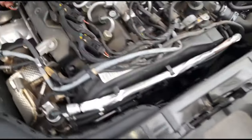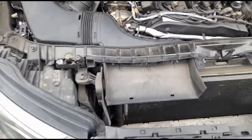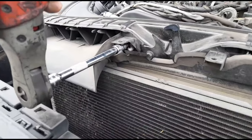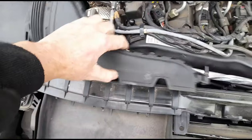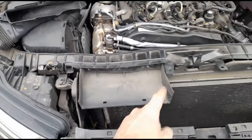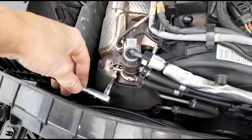Anyway, I've taken off these plastic clips and we can remove this front piece of plastic. Just in here we've got a couple of T25 Torx screws. You can take out this plastic — you can see where the screws come in around the back. There's one screw on each side using a size 5 hex, and I'm going to open up the AdBlue injector.